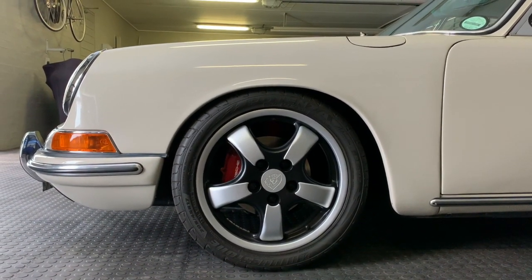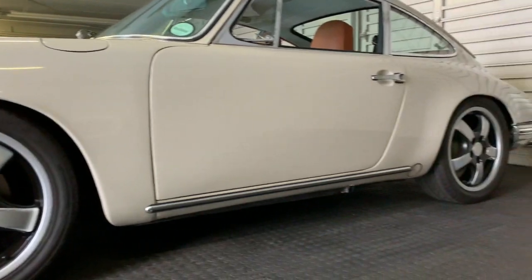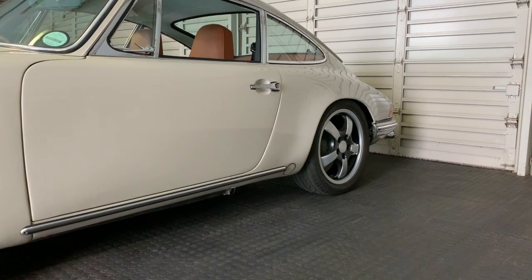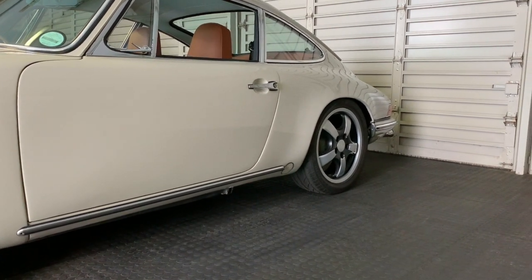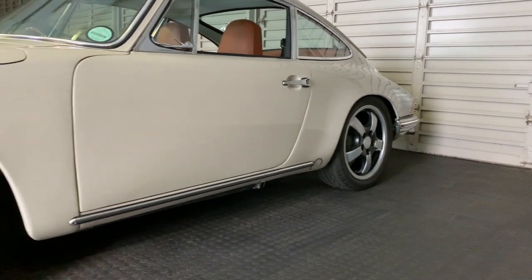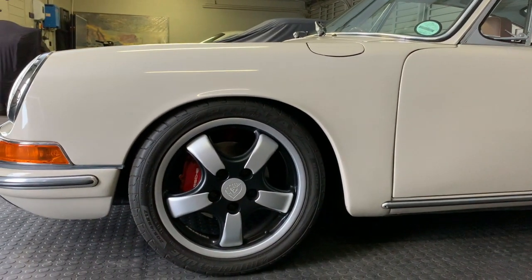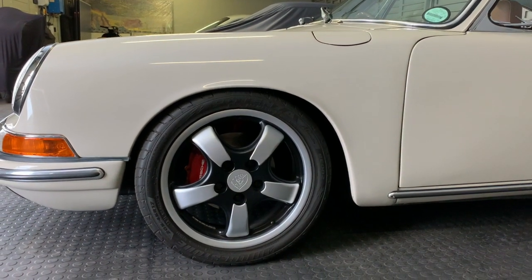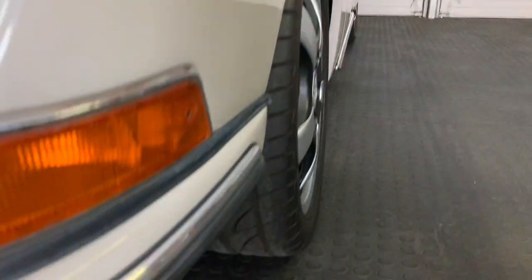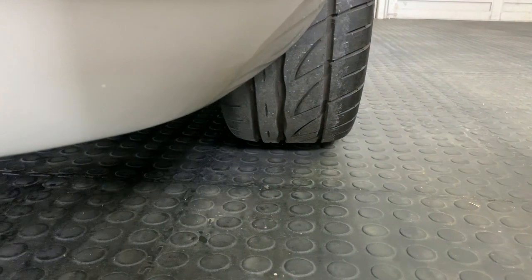It's a 17-inch rim. All of them, in fact, are the 7J profile off the front of a 964. The offset is obviously a little bit more wide, to use a non-technical term. So what we then had to do to ensure that they fit within a very narrow body on the inside was to in fact split the rim. So just to be clear, splitting the rim that way, removing an amount of material and bringing the rim in so that it becomes a narrower wheel, which then can sit inside of the car.